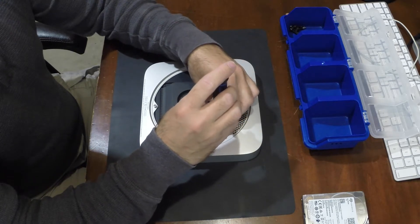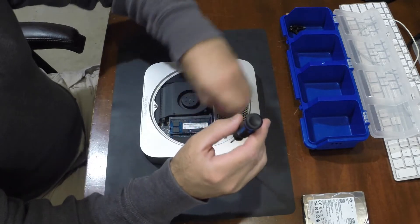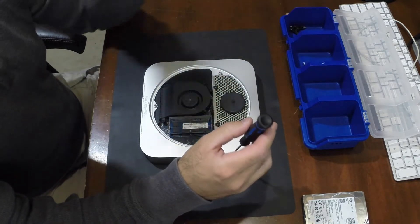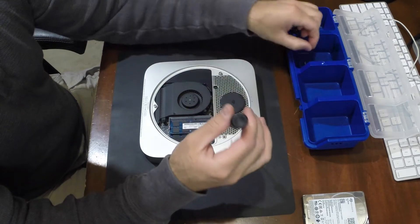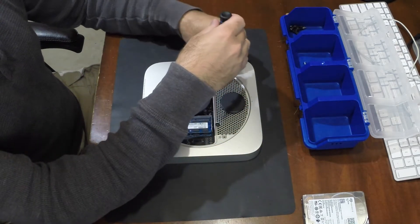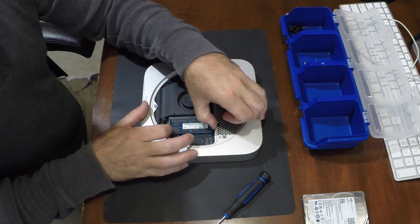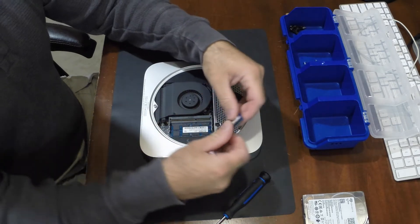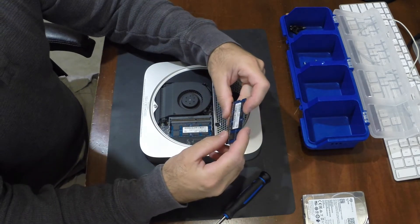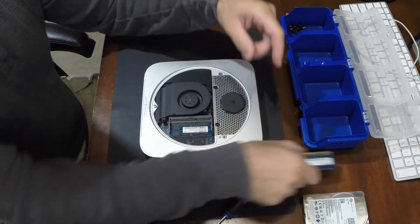From the beginning I have to say that I would not recommend anyone to do this because there is a risk of damaging your computer. The ribbon cables that connect the hard drive to the motherboard are extremely fragile, and replacing the regular hard drive with a very thick one will require rebending and reshaping those ribbon cables, which can damage them.